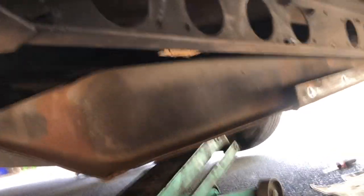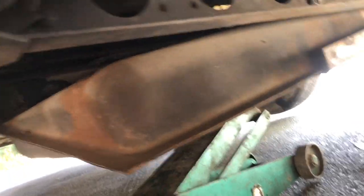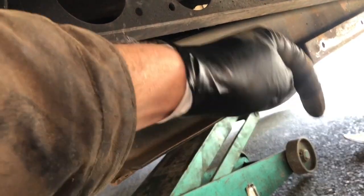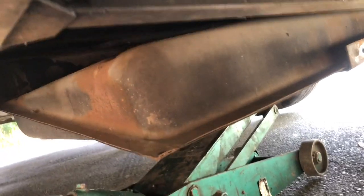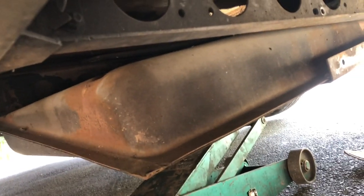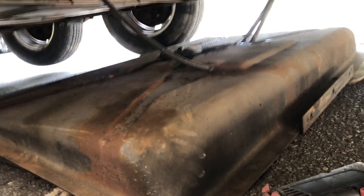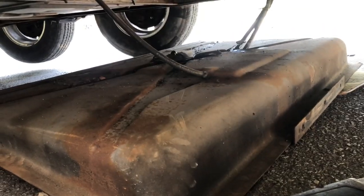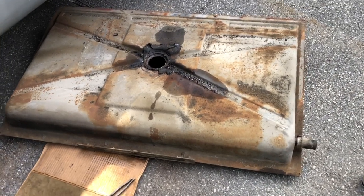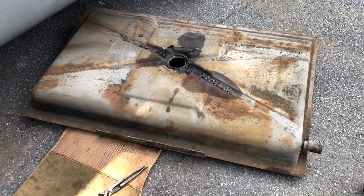So now I'm letting the tank drop towards me. I've got it on my jack, and this way I can pull it in this direction off of the filler tube over there and then hopefully drop it down. That was pretty damn smooth. I just got to get this vent line off of here and then we are on to the next one. Still no surprises — that's one of them out, pretty quick. So now I'm going to get the other one out, same procedure.